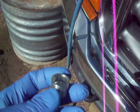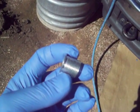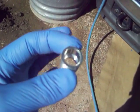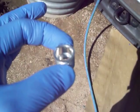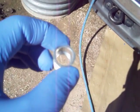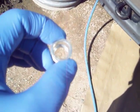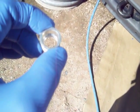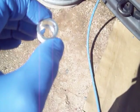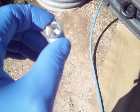The problem with this insert is that it's fully threaded on the outside, as you'd expect — it goes into the threaded hole we just cut into the head — but on the inside it's only threaded partway, about four or five threads, matching the factory original. It's a steel insert so it shouldn't pull out like aluminum threads, but the reason it's only half-threaded inside is to match what the factory had in their OEM setup, for the Motorcraft plugs that only have threads partway and have a shoulder — they won't go into a fully threaded insert.